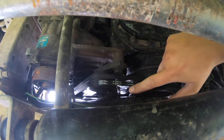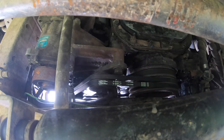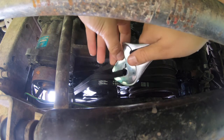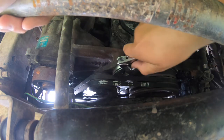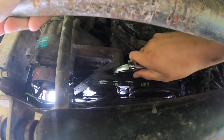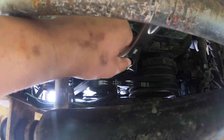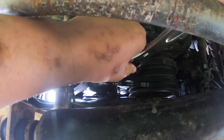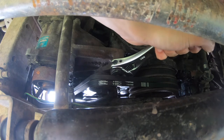Here's our jockey pulley — we need to loosen that nut and slack things off so we can pull these belts off, hopefully without pulling the pulleys completely off the alternator (which would require two people to get back on). I take a big shifter mostly because I can't get my socket on there with the belts in the way. It feels like I almost rounded the edge off, which is not ideal.